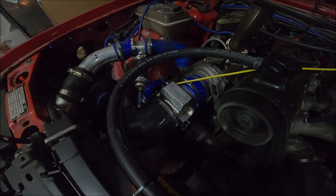But I told him to leave the fuel alone, because it's close enough. It's not perfect, but remotely it'd be too difficult for me to explain what needs changing enough that he could accurately do it. So I said, leave it, it's not a problem. And ignition, I said, because it's so dead low down, if you can make any ignition timing changes that might improve that, go for it. But I don't expect you could, because ignition timing isn't magic. You can't make a low compression 2-liter engine with a big turbo suddenly a fucking V8 with low down power. But we'll see.